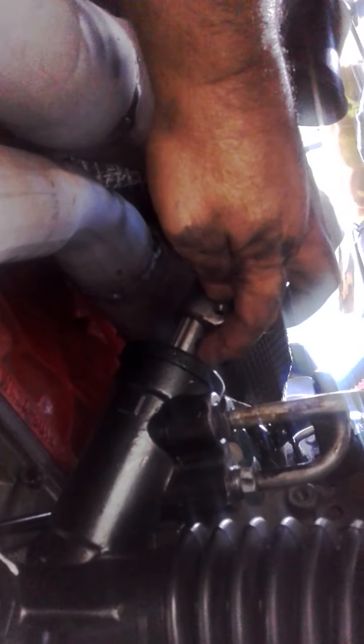They are pretty tight. Alright, that's going in pretty good — I'll have to tighten everything up. Usually you've got to just put a lot of pressure on there and tighten up that bolt — 18 millimeter. Alright guys, if you've left your steering wheel in the right position, getting this universal joint on isn't a major issue. You come from above and then just simply get it close — that bolt hole there lines up with that spline there. It should go on one way, just give it a bit of a wriggle so it lines up. Once it's down low enough you can put your bolt through and tighten it up.